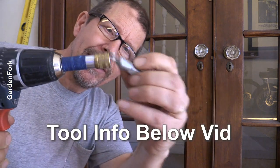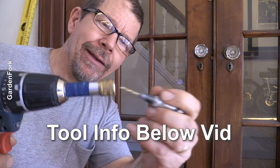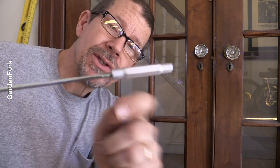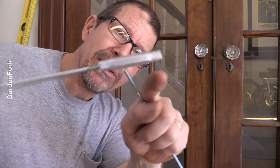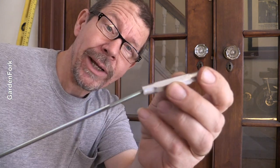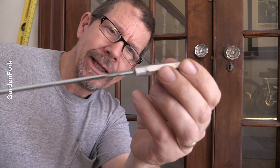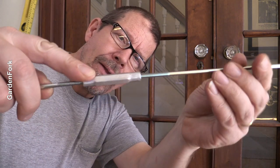It is a flip bit, drill bit, and screw bit. Come in handy with this, okay? Spin this out so you can have as much thread exposed as possible, but still having thread engage the end of the turnbuckle. That's all the way out, so we wanna go, and this one's the left-handed thread, so you're kind of thinking backwards. So I want some tooth in there, I want some thread in there to connect this, and do the same thing on this side.